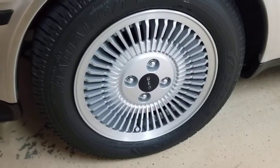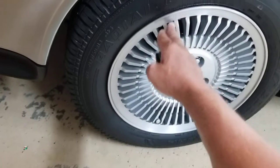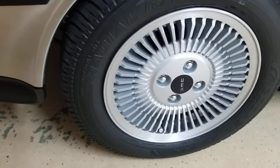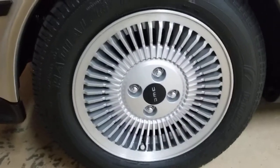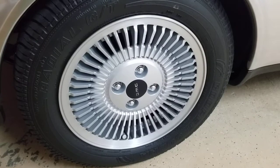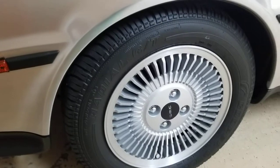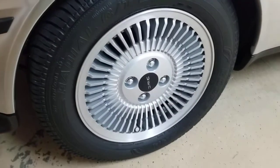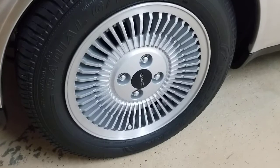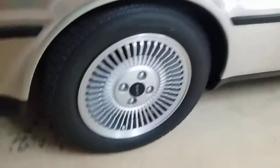The wheels are machined finish wheels. These are not exactly like the factory wheels, as the factory wheels were all powder-coated. These have been powder-coated, but it's been sanded off the lip and the fins — the faces of the fins — and then cleared, and it really looks nice. I've also got different lug nuts on, as the original DMC lug nuts have a bad habit of having the caps come off. These are Honda lugs. There are some new ones out that probably fit a little better, but I've had these on for about six years now with no problems.